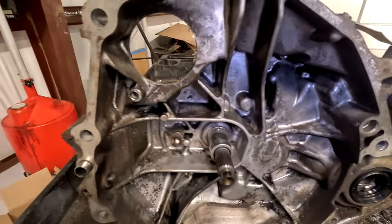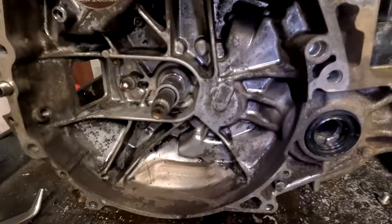You kind of want to clean out this a decent amount — you don't have to go crazy, but at least make it halfway decent where it's not horrible garbage everywhere. Trying to remove the seals on both sides. The puller you use needs to be a good brand — I bought a cheap one from Harbor Freight and it has two different kinds of teeth on different angles so you can pop it out depending on how big the seal is. But mine wasn't perfectly straight and the thing went a little sideways and bent. This carpenter one works as well — you just put it in and flop it out. You do that on both sides, clean it all up nice with a rag, and then we can pop in the new seals.